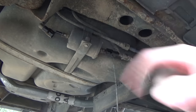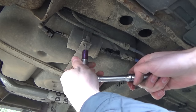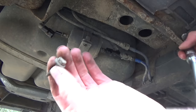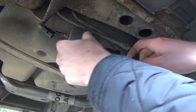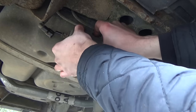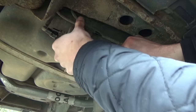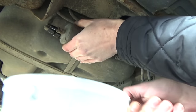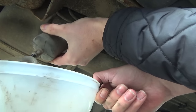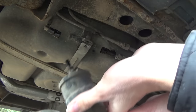That's just the fuel left in the filter coming out. Once that's drained, I'm going to remove this 10mm bolt and then we can pull this filter out. This just pulls down and the filter should come out — be careful because there's probably still going to be petrol in it. There we go.